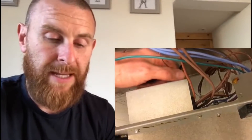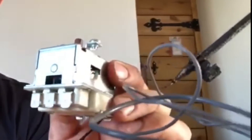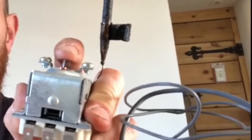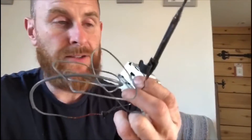That led me to believe there was something probably wrong with the thermostat switch. This is a three-pole thermostat — you'll notice it's got a sensor that goes up into the actual fryer unit, and then there are terminations on the back, so it's three poles. Basically, when you turn the fryer on, it operates a little thermostat inside which operates a switch and then allows electricity to go down to the actual heating elements. That had gone wrong.